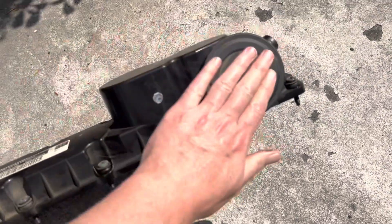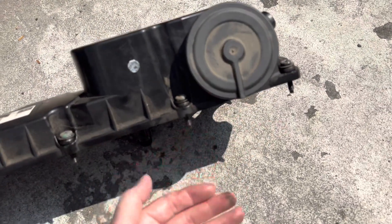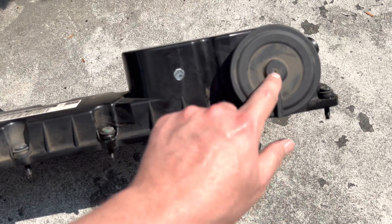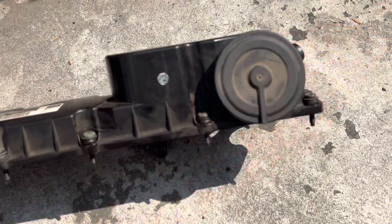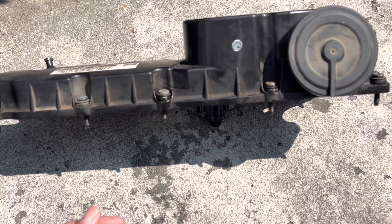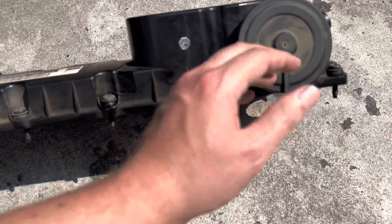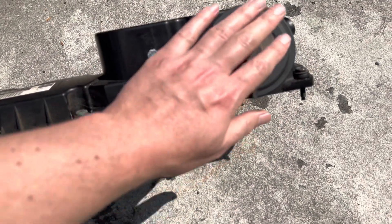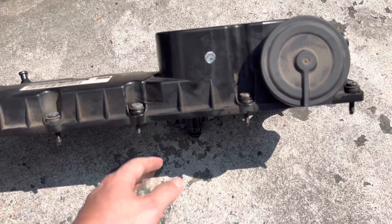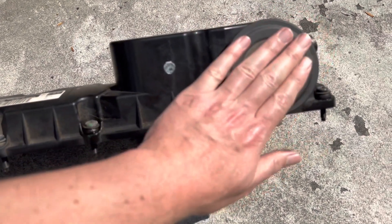You have outside positive air pressure pushing down on here — positive pressure on this side, negative pressure on the other side — so it's going to pull the PCV diaphragm membrane down and close off, basically block the airflow. Then as soon as there's enough pressure built up from the crankcase blow-by, it'll add pressure underneath here to make it more equal to the outside pressure, which ends up pushing this diaphragm open — only until the pressure under here is reduced enough to the point where enough vacuum is present again and positive pressure pushes it closed again.